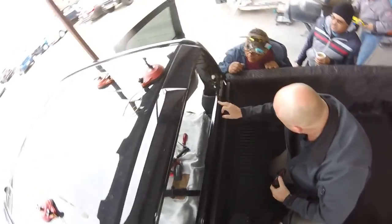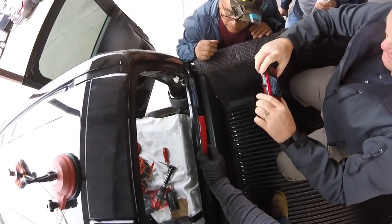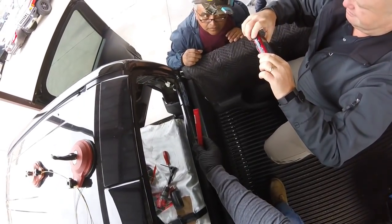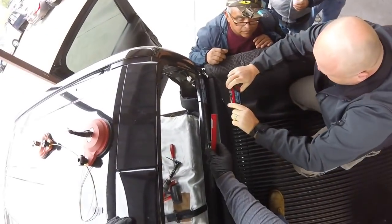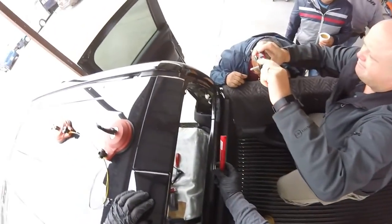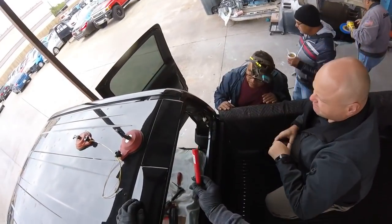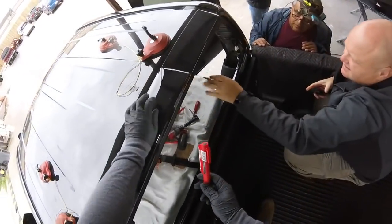See that there? Yeah, they start coming on this one too. You see when it's flat? There's a contamination. Maybe they contaminate the frame of the glass, because when the warehouse handles the glasses, they come in with the oil when people touch it. Gotcha. Yeah, so we got to clean it very nice. Use activator, wait 3 minutes, put primer, wait 3 minutes, and after that you glue going.